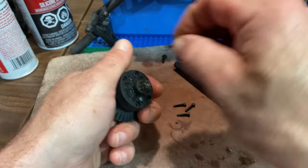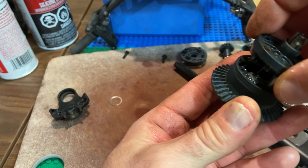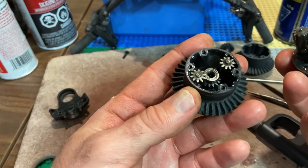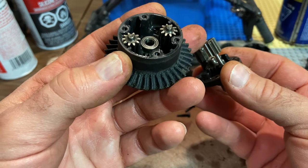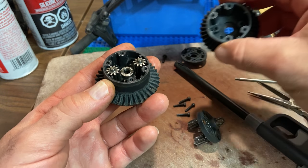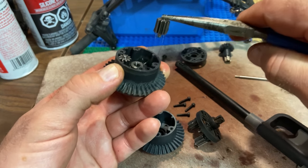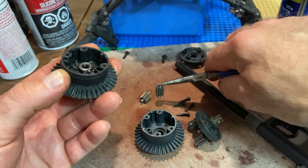There are four screws on this to take the lid off the diff. It looks a little overwhelming your first time, but it really isn't a big job. These planetary gears — the small gears and the posts — are all identical. Once you pull them out, give them a cleaning. Here's the new crown gear — we're just gonna take the old planetary gears out and throw them right into the new crown gear, add oil, close it up, no problem.